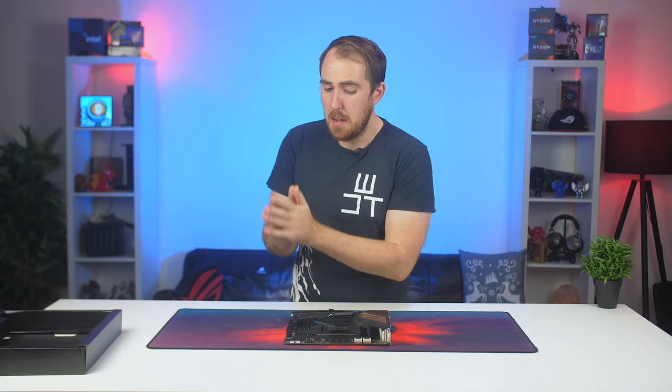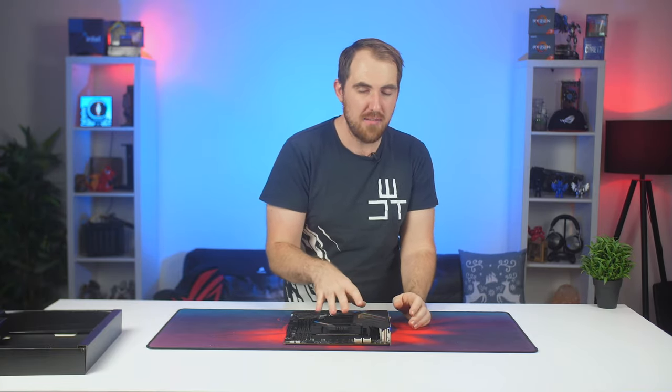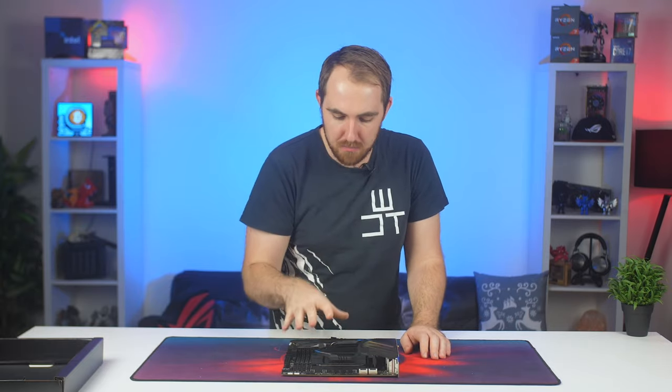So keep that in mind, but luckily there is going to be an alternative board if you want to go for that. I'm not sure if this version is going to have that, but you are going to be able to get DDR4 models of the exact same boards as well. So if you already have a system and you just want to upgrade your CPU and motherboard, you don't have to buy different RAM and pay a lot and get stock, of course. Personally, I would rather go for something like that if I was to upgrade on my own. So that is going to be an option later on, but I'm not sure on the stock or availability for those boards yet, or if all of the boards are actually going to come out in DDR4 versions as well. Not sure about this one again, but you are possibly going to have that option.